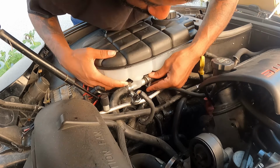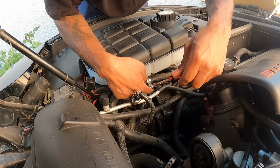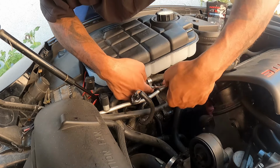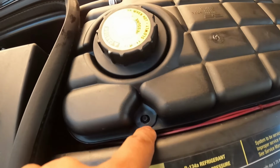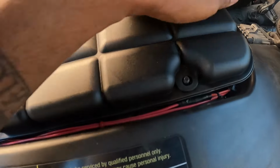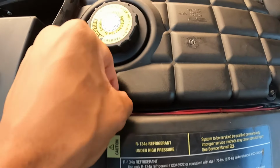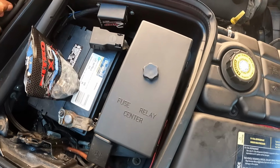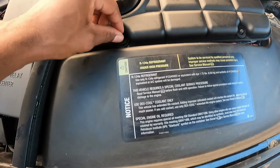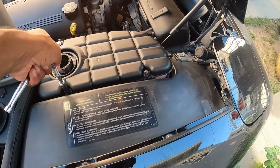And then tighten them up. Make sure you don't crack anything. If you're using your regular clamps, you have no issue with that, of course. The holes on the new reservoir are kind of small, so you have to force this down just a little bit. Make sure you get that third tab in behind that bolt. Make sure you're not squeezing any wires or anything. And then once you get it down enough, you can just put the bolt on and start securing that.